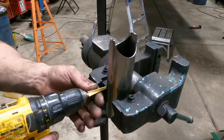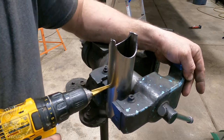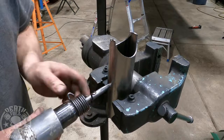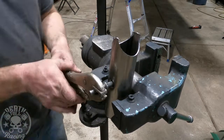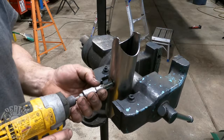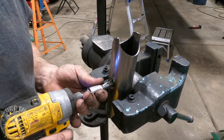Punch and tap on your oil pan for a turbo return — here we go. The bit I'm using is basically a step bit without the steps, it just came from Harbor Freight. I like it because when you punch through it doesn't shoot through on you and the chips tend to stay in it, so I felt like I had a little more control. The diameter of my punch is the exact diameter needed for the pilot for quarter-pipe. You may have to get creative and grind yours down. I'll run the tap through and go straight to three-quarters of the way — same demonstration, works out pretty good.